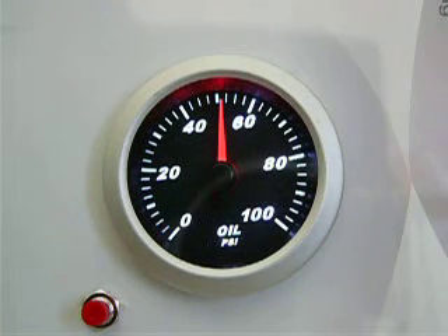The SCX Pro gauges also feature a 12-volt output that is activated when the gauge is in alarm mode. The external alarm output can be used to activate and deactivate lights, electric fans, water pumps, switches, and more. For illustration purposes, I've connected a warning light. Note how the light is on when the gauge is in alarm mode and off when the gauge is not in alarm mode.